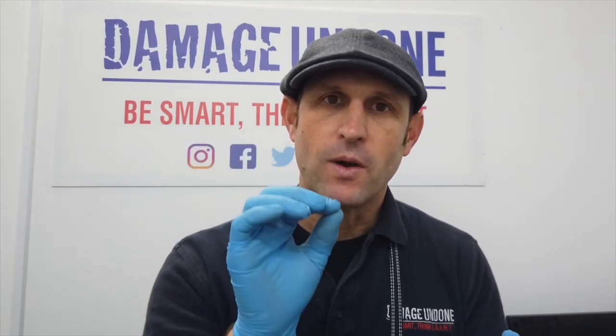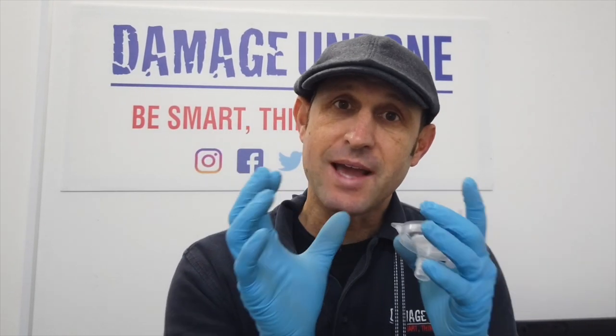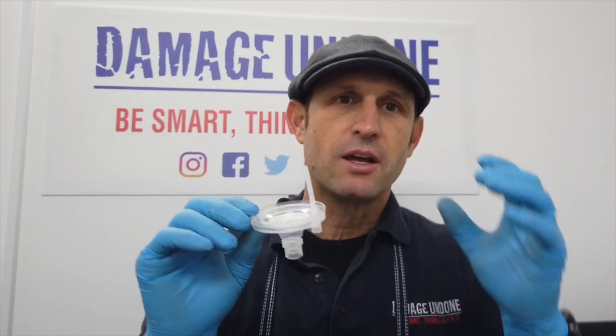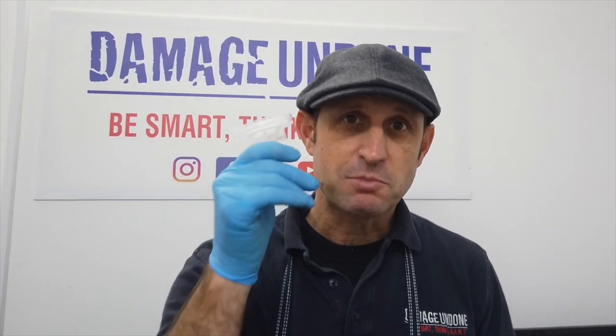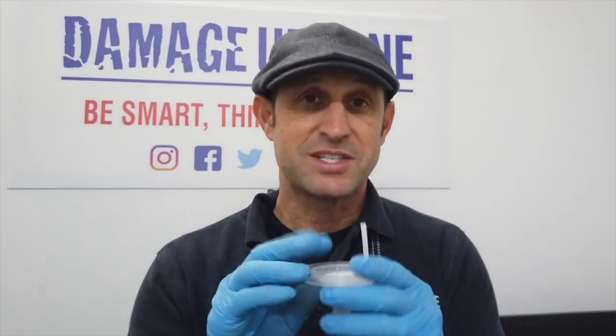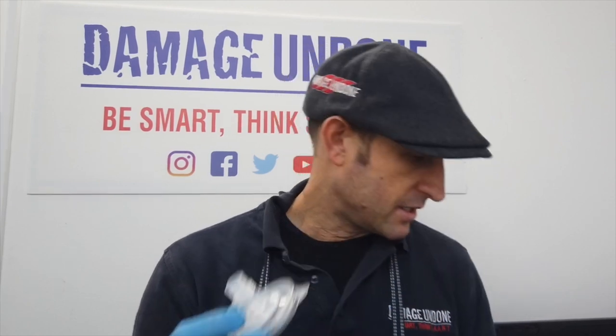The reason I love the 90 micron is because it strains so well. With solid colors you can get little bits in your paintwork, and if you're using a 125 micron strainer or something slightly larger, those bits will pass through into your gun — you can even see them gathered in your strainer when it's dried. Using a 90 micron totally eliminates that. In the old days, up to a couple of years ago, I was using two or three strainers just to filter solid colors. I don't have to do that anymore — it's straight into the cup and into the gun.